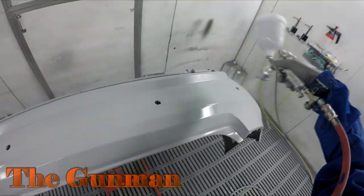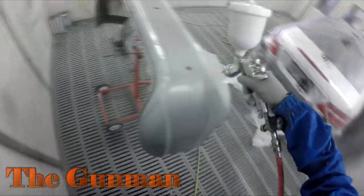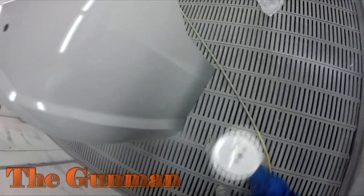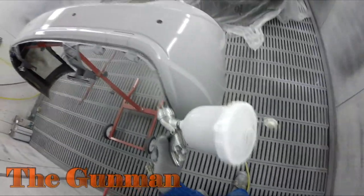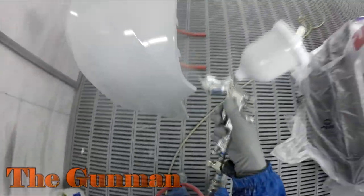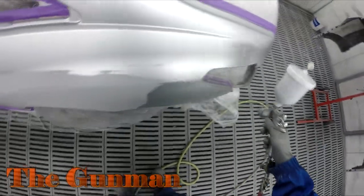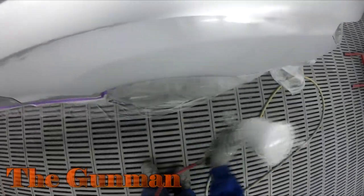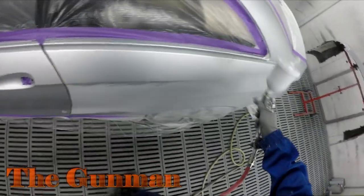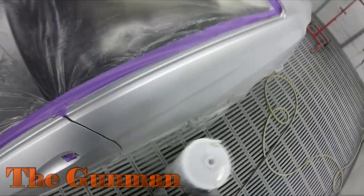This is a Standox non-stop wet-on-wet primer. They've got a black and a white, and at the moment I've been eye-mixing the shade I want. I need to get one of the paint rep guys in to see if they've got a value shade system like they have in Chromax — I'm sure they do, I'm just not familiar with it. Back in the day when I used to work here I never used wet-on-wet primers; I'd just use 1K primer or ground coats. But since leaving and coming back I've started to see the benefits.